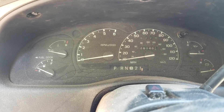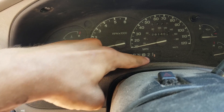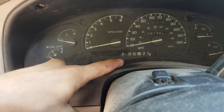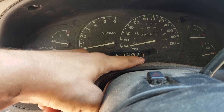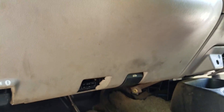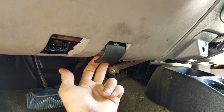This is a 1998 Ford Ranger, and you can see this little needle right here that allows you to see what gear you're in — it's out of alignment. To get this panel off, there are two Torx 20 screws back up in here.